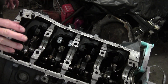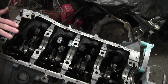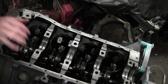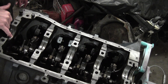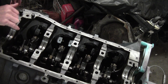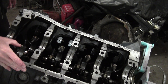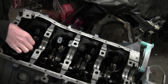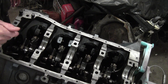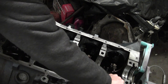You can tell that was Ford thinking way ahead from the mistakes they made way back in the past. I kind of geek out on that kind of stuff. I went through, I checked all the bearings — they're fine, they're better than fine. The only place I see a little bit of copper is right here, and it is minimal, so I'm not even worried about that. Went ahead and pulled them, cleaned everything, cleaned it again. Now I'm ready to set the crank because everything in here is better than ever. I also checked the bottoms of the cylinders — everything in here is just pristine, ready to go.